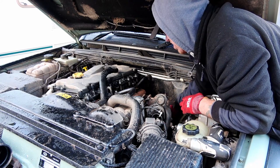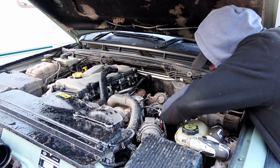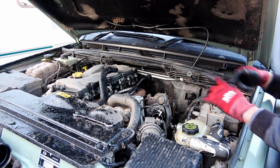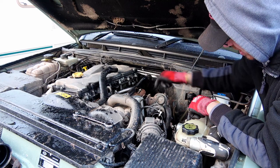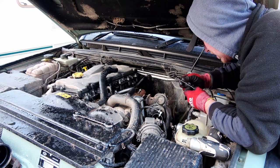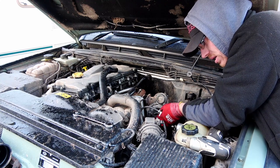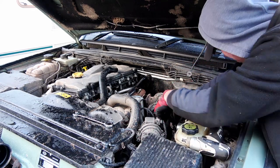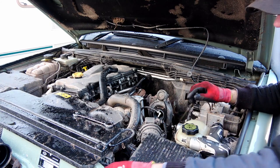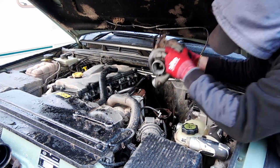Be careful for your knuckles. That's 3 bolts out. There's an oil feed — I'll try and remove it. There's an oil feed that goes to the bottom, right underneath the oil feed for the top. Two bolts on the bottom of it. Taking it off — be careful. There's the gasket, and there's the bolts. That's the hose there, and that's it — turbo's off, easy as that.